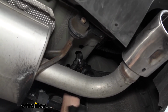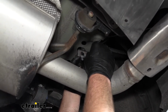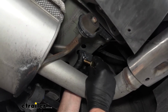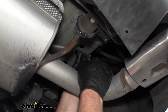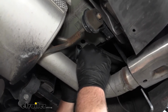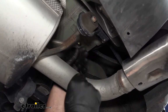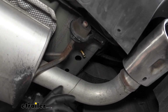What we're going to do is take a spacer block, slide that over the coiled end. We're going to take our carriage bolt and thread that on to the pull wire. Then we can feed our hardware up inside of the frame rail. Pull down on the fish wire and have it drop through like this.